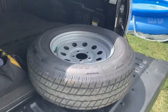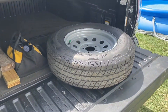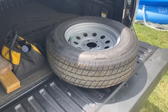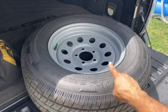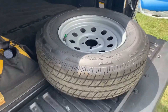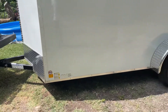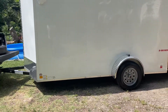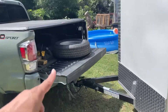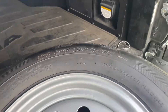I never had a spare tire — so here is the spare tire for this trailer. I bought it during the week and it cost me about two hundred dollars, tire with the rim included. I went to the dealer where I bought the trailer and they gave me a 14-inch wheel, but I had to go back and get the right one — a 15-inch, this is a 205/75/15.